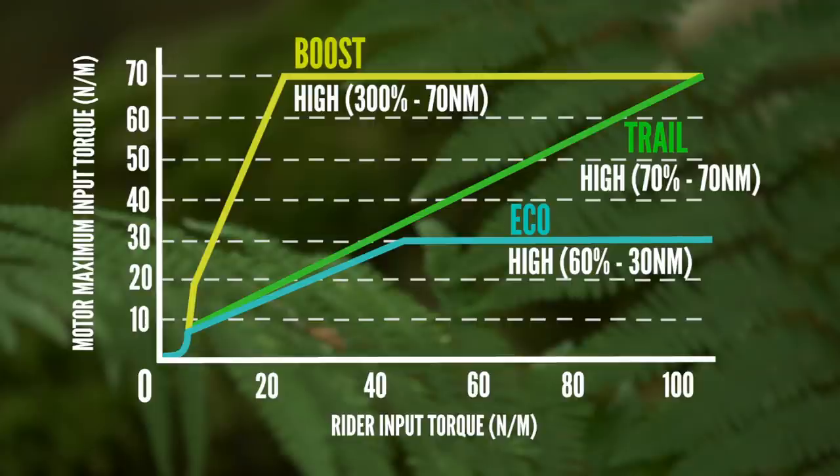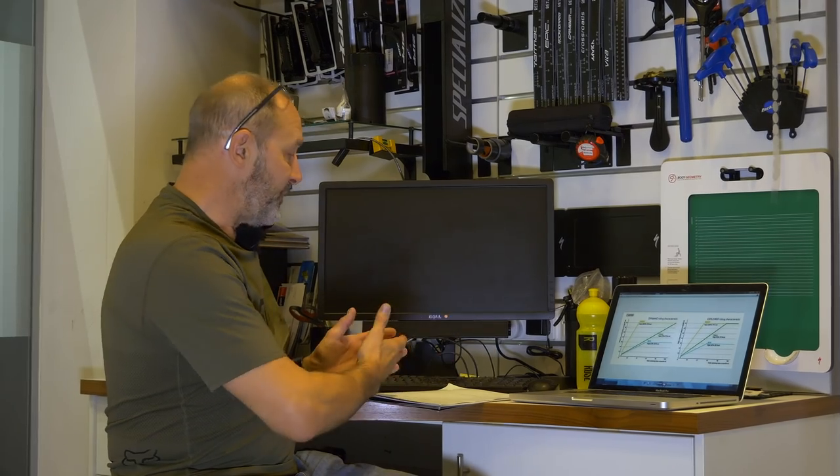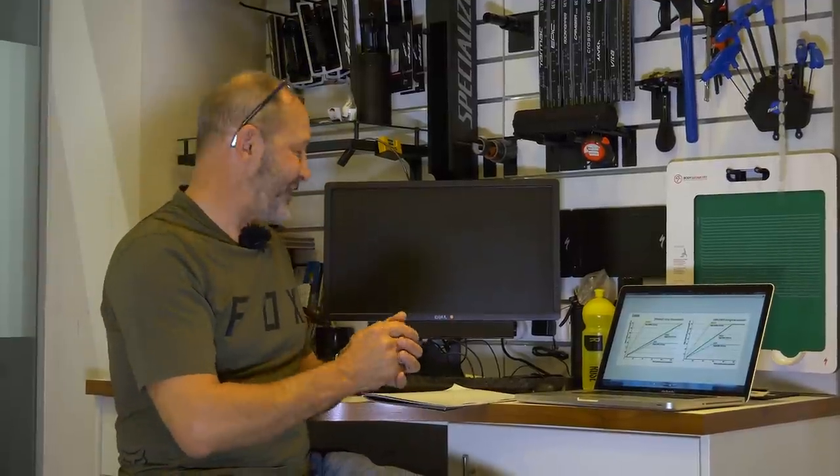Right, I hear you're about to ride the E8000 — is that right? Yeah, that's right. I've been looking at the graphs, and the graphs that Shimano apply don't really tell you what you really want to know. In cycling, power is everything — it's how much power you can divert for how long a period of time. The graphs they've given are basically a multiplication factor of torque input versus torque output. You don't know what power or cadence is going to be developed. Looking at other curves we've found, you can see that probably the best power is developed between 60 and 90 RPM on your cadence. If you get over 90, it'll drop off pretty fast. And comparing it to other motors, it doesn't quite have as much power as others.